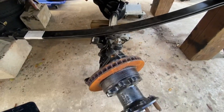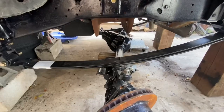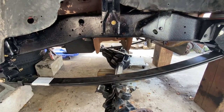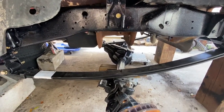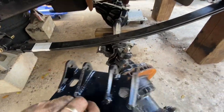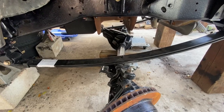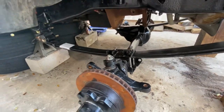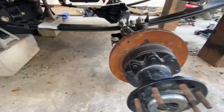The axle is now under the truck — that's a big milestone. Going to get it bolted on, make sure the track bar is in the right spot, and install the dual shock mount bottom plates with new U-bolts. Once it's up there, it just slipped right in — no problems whatsoever. I put it under there by myself with floor jacks. The rear shackle brackets are all in, everything finger tight.